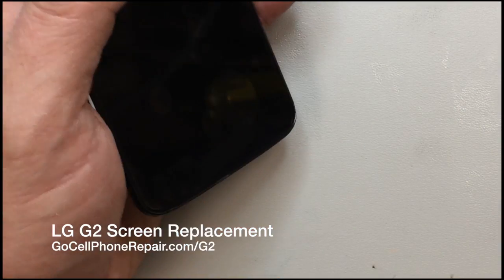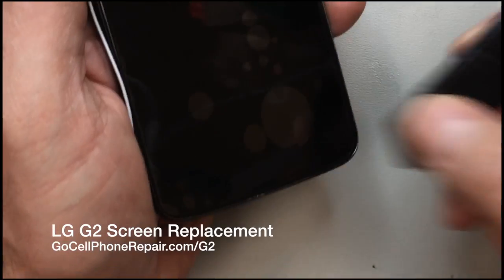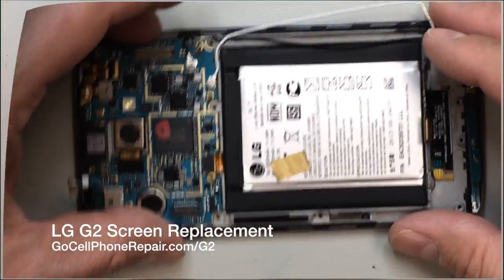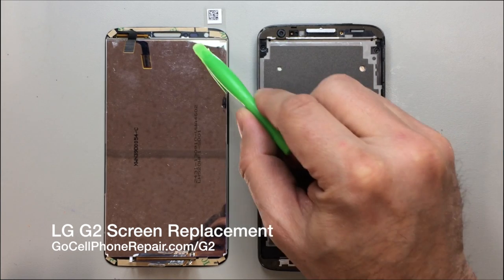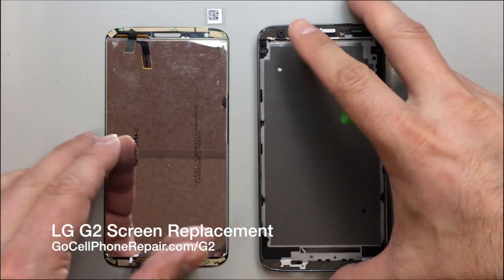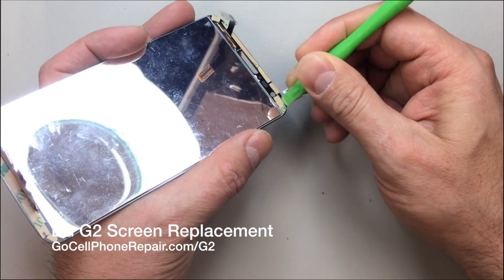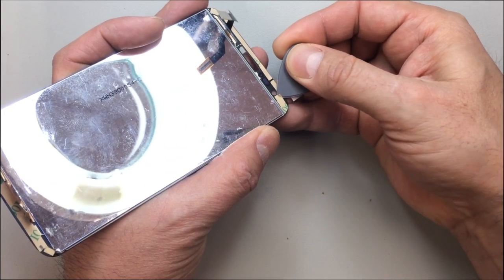At this point we're going to heat up the front of the phone and take your pry tool around the edges where the glass is. I'm not going to do it on this one because this is a brand new screen, but be careful — if you use a metal pry tool you don't want to scrape up the bezel. Best thing to use is plastic. Once you get it started, work your way around with a little heat and you should be able to pull the whole front off. You'll be looking at something like this — the adhesive is really just at the top and bottom, so it should come off pretty easy. Add new adhesive after you clean the surface, and make sure you do not block the windows at the top for the front-facing camera and the proximity sensor — otherwise you're going to have some problems once you get it back together.